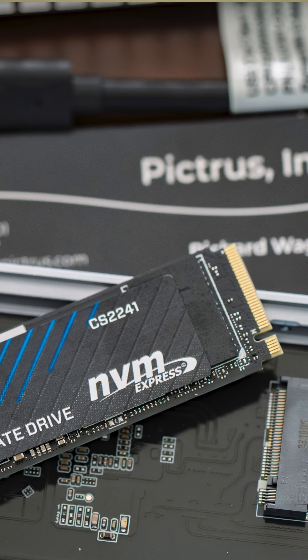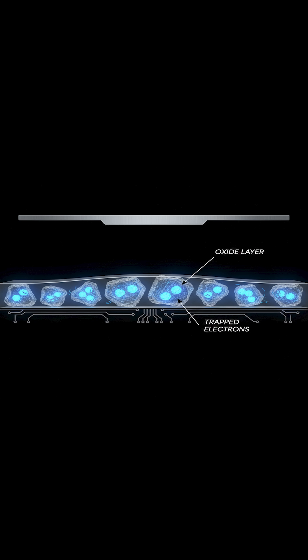And the reason for this is that all SSDs rely upon NAND technology. When you write to NAND technology, electrons get trapped in a thin oxide layer. When you unplug the drives, electrons, over time, can leach out of this layer.